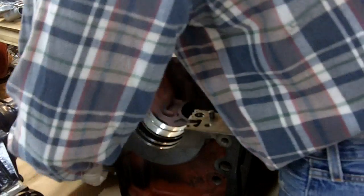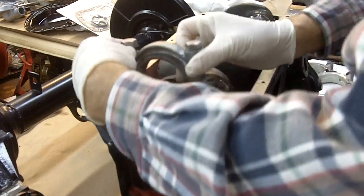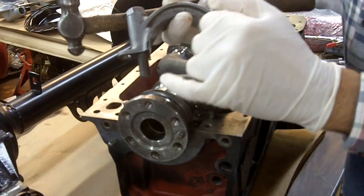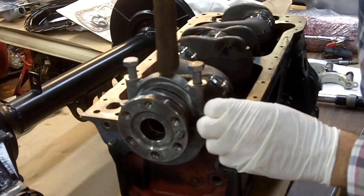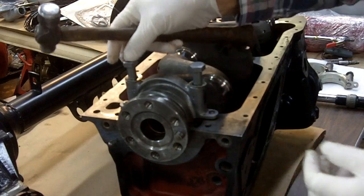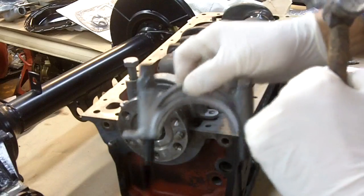We have a crankshaft — it's already ground and ready to go. Now we will install our caps and torque them into position. Notice that these caps have a very shallow footprint compared to the later style caps which are much thicker — it's a production change. It doesn't really matter a great deal because you still have a tremendous amount of meat here to torque down the main caps. Also, be aware that the factory wants you to use wave washers — the early engines used flat washers, but we're going to use wave washers now. Make sure your special bolt for holding the oil pump in place is where it's supposed to be.